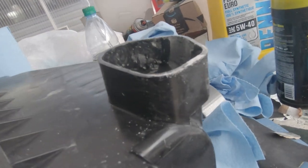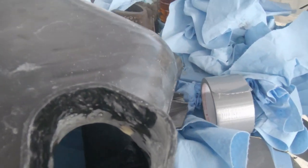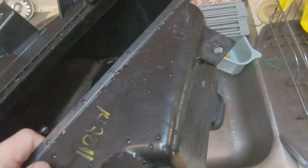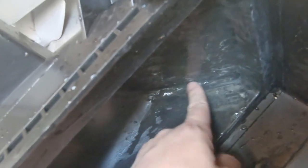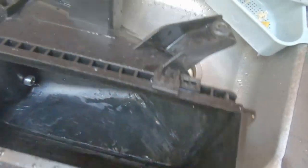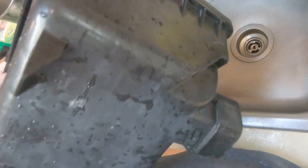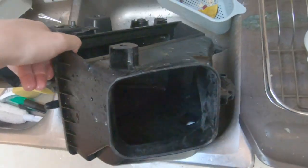This isn't a main source of air, so I'm not super concerned. Big improvement over stock. Just cleaning up the dust and doing a final inspection. I think I'm pretty much done. That is looking really good - all the bubbles and contours, wherever it changes direction. We're not perfectly smooth, but I wasn't really trying to get it perfectly smooth - just trying to avoid the real rough stuff and hard edges, which I don't feel a single one of now. Even up here where it was really bad, it's nice and smooth now. Just going to keep washing this thing out, dry it off, and put it back together. I might have to do a little bit of touch up where the filter goes just so it makes a good seal. I ran out of hardener, so let's keep at it.